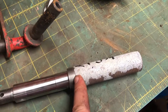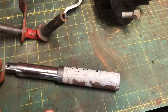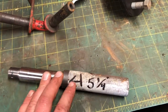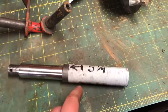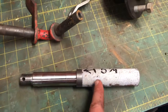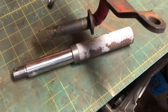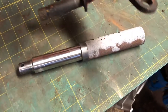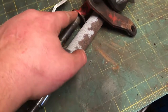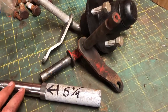The edge here is where your bearing seal rides. On this one I figured I wanted it five and a quarter inches from the very end to this end here, so I marked it at five and a quarter. I'll stick this in the lathe and cut it off at five and a quarter inches, then bore it out on the inside to three quarter inch — long enough so we can stick the original spindle inside of it. Once that's bored out we'll put a little chamfer on it, then take it on the spindle and weld it right around there. That should hold it fine — it's a little upgrade.